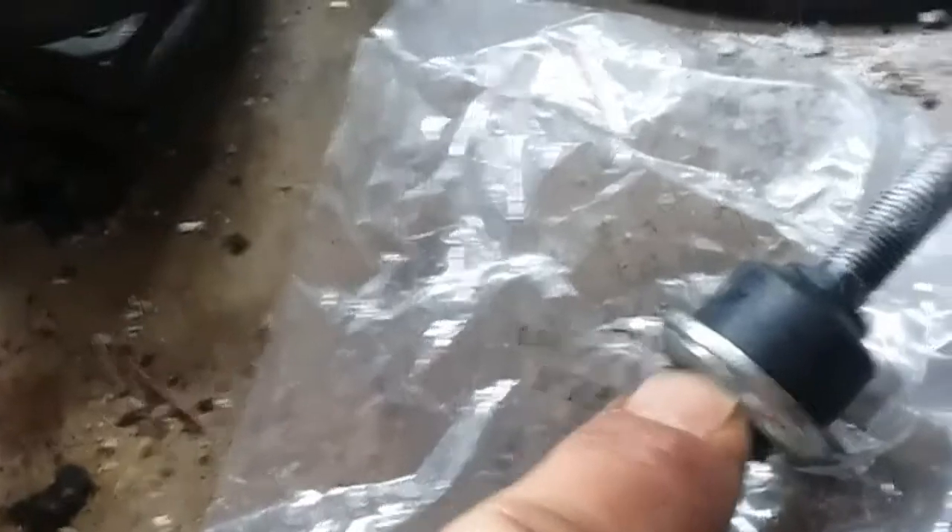This cup washer and this rubber — I've got the shaft. I put a real light coat of grease on, which a lot of people don't want to do because it collects dirt. I don't care about dirt; I care about that thing rusting and then tearing up the seal down inside of here. I also put grease on the shaft here where this bushing is going to sit, and inside the cup — again, keep it from squeaking, keeps the wear down, and will make it not rust. Got the tie rod end back in place with a new cotter pin. You never want to reuse cotter pins — just don't do it, it's not safe. I've got it all greased up. You can see the grease on the end of the zerk fitting there. I've got my compressor out of there, so this is all installed as one unit. I just need to get the shock in and then this side's pretty much done.